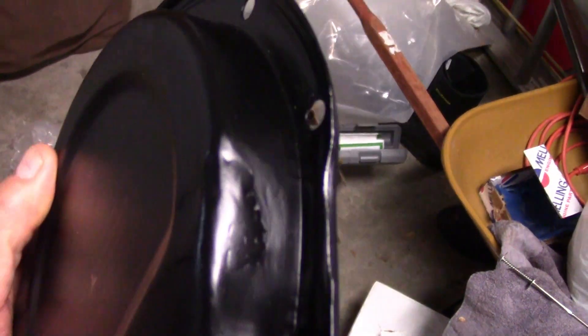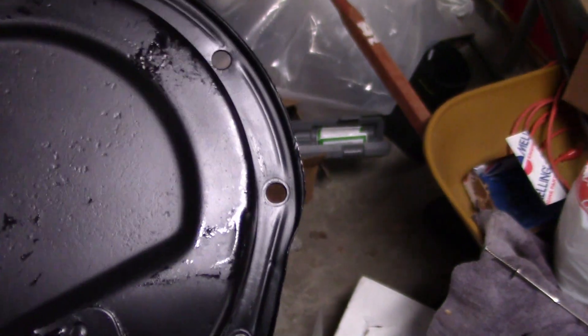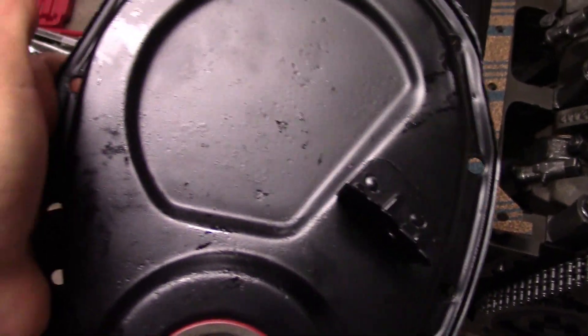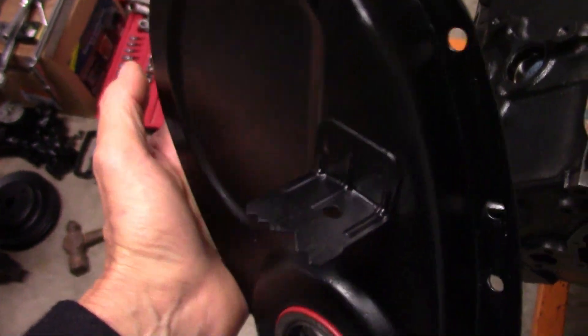So I got my son-in-law, who's a pretty good welder — there you can see the bead. He got out his MIG welder, welded that up, ground it down, flattened it out, and turned it back into a nice cover. These covers are not standard — depending on the year, the timing pointer goes in a different place. I couldn't just go buy one of these covers with the timing pointer attached; to try to stay sort of original, I wanted to save this cover.